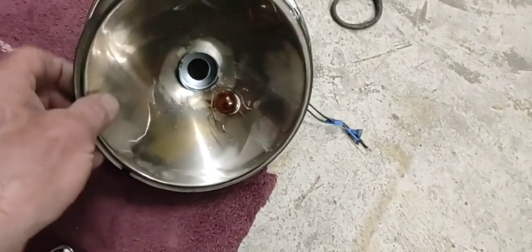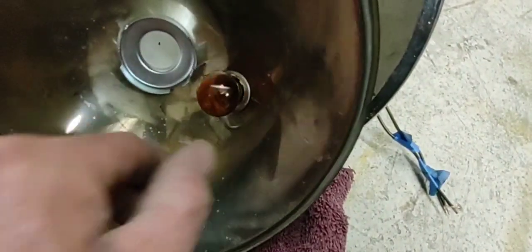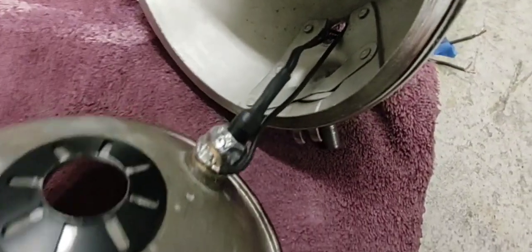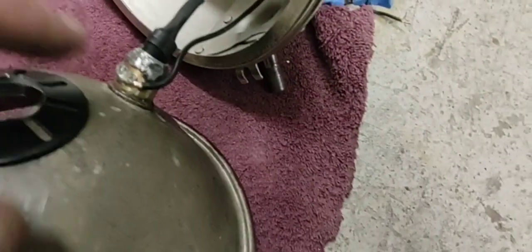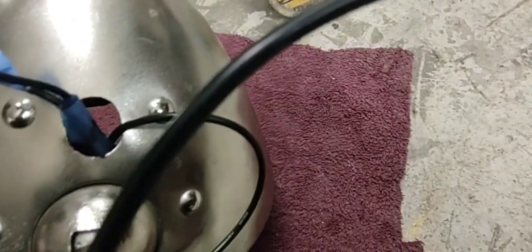yeah, wicked fast. So I messed around with this headlight more and more, and I did get the bulb in there, and that's where that little clip holds the light in there. It just goes in there like so, and that snaps over, holds her in there. I did get it all soldered in there. She ain't the prettiest, but she's functional. I did solder a ground wire, and I just soldered that sleeve into that socket there. On the bucket here, I did end up notching that out a little bit there, and I oblonged the hole just a little bit. You can tell, well, the wires are in the way, but not bad. So that pigtail fits in there good.